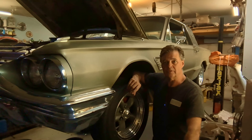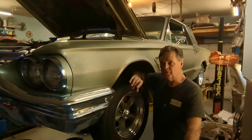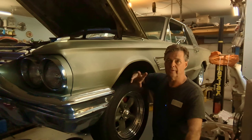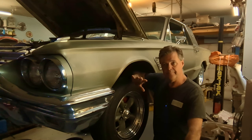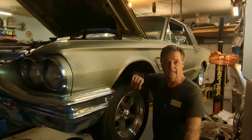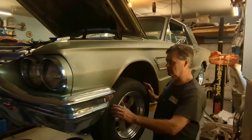These are a four piston brake caliper. The pistons are chrome plated. They're not a complicated setup. There's only an O-ring in each piston and a dust seal. But these pistons can get stuck in there very easily. And I think that's all that's going on in here.